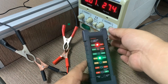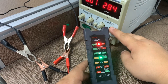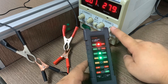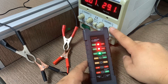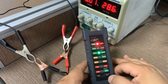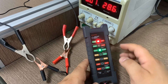For the truck battery, the condition shows in the middle range. If we adjust to 27.4V, you can see the battery condition changes to good. If the voltage goes too high — over 29V — it will show a fault, indicating the battery is not in the correct condition.